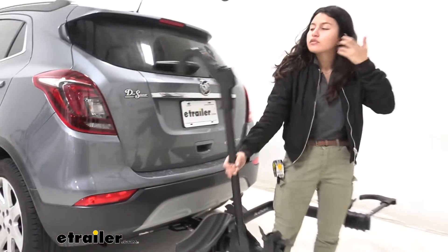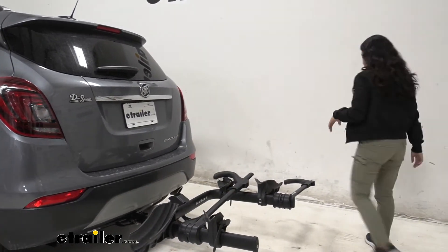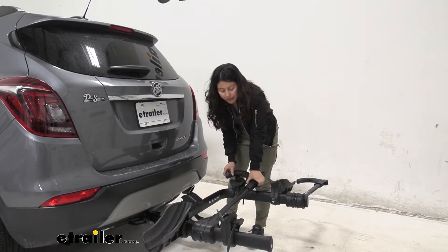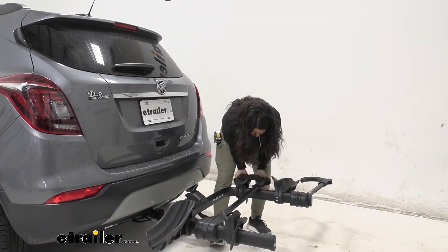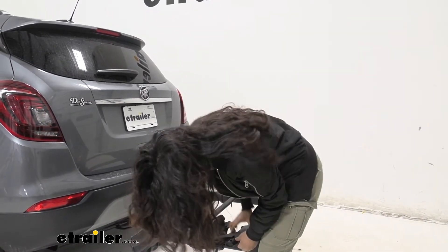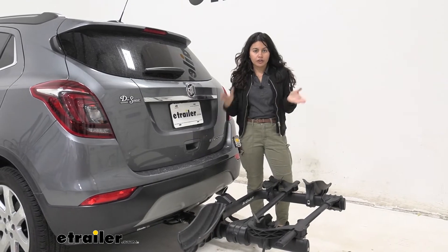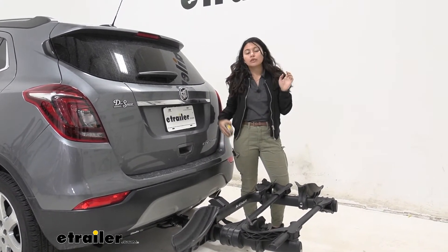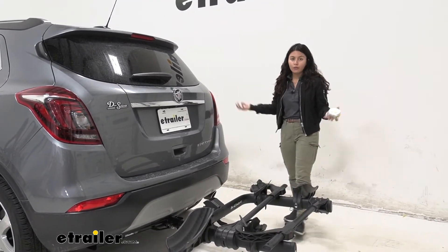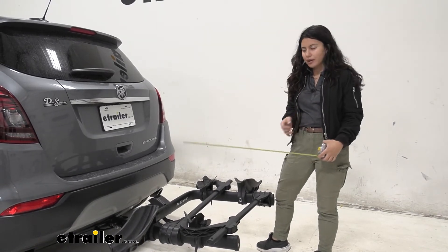Really doing most of the work is going to be your front wheel clamp — this goes down on your front wheel, and you have different options for clamping it. I like to clamp it on the outside of the goal post so I can keep that area open. That's one clamp and then two clamps. This has a 40-pound weight capacity on the inch-and-a-quarter version; if you have heavy electric bikes, I do recommend getting the two-inch hitch receiver version for that higher weight capacity.